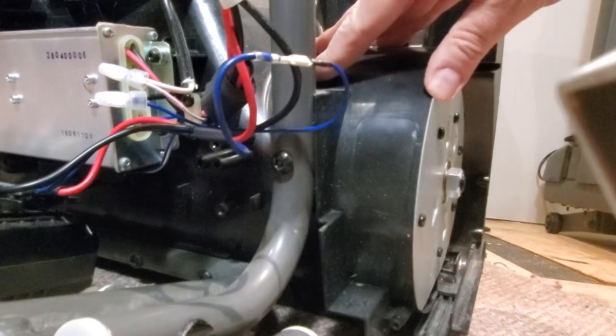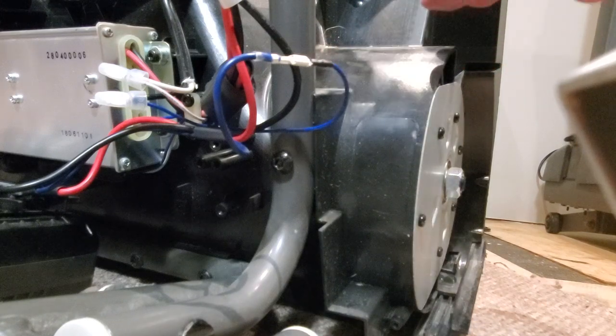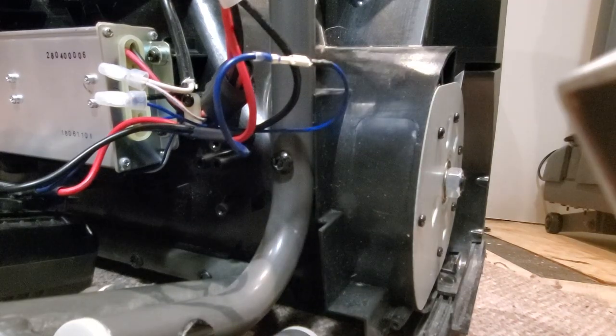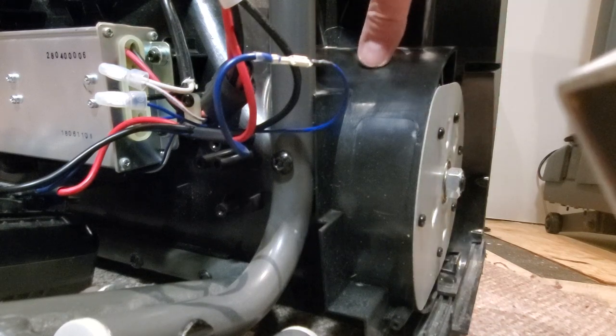Generally, you don't want to have, well, static electricity is generated when you have two dissimilar materials rubbing against each other. So you have the super dry snow, which is not conductive because it's super dry. The humidity is very low, brushing against the plastic, and that generates a static electricity on the plastic shell. So we need to discharge that.